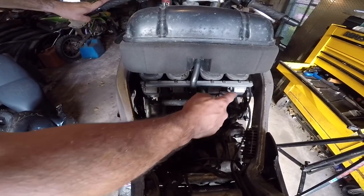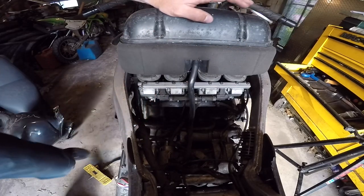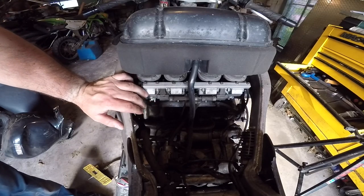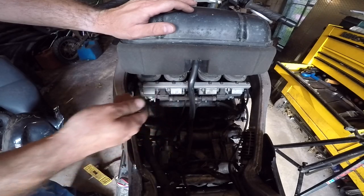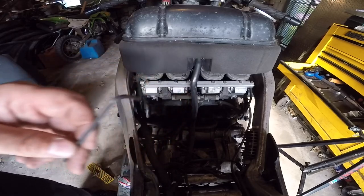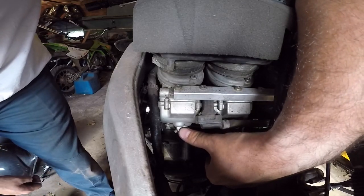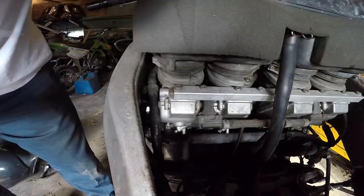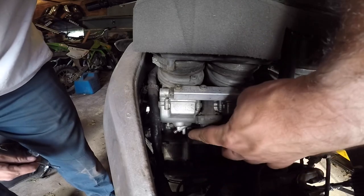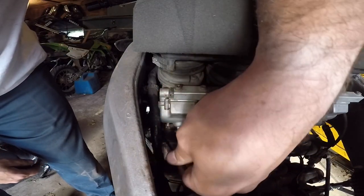Down in here, these four things are the carburetors for this bike. They deliver fuel to the engine, and one thing you need to keep in mind when putting your bike away for storage is you need to drain these. To drain them you just take a screwdriver or an allen socket, whatever the drain screw is. Here's the drain screw I'm talking about — this little screw at the bottom of the carburetor. When I loosen this, no fuel should drain out. So we'll open that up and as you can see there's no fuel draining out, which means I must have done that.